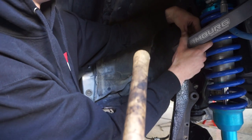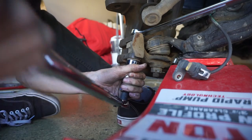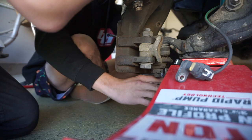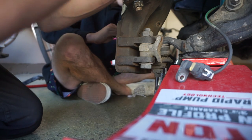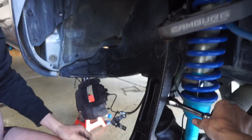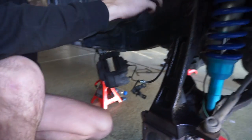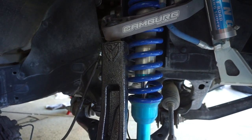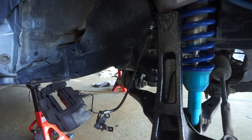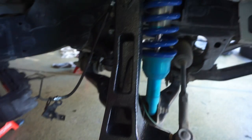Would you care for a mallet? This is making my life so much easier on so many different levels. This is some of the stuff I was cussing out and complaining about yesterday at like 7 o'clock at night trying to do these by myself. Now we just need to wrap a 19-millimeter around the castle nut on the bottom, tighten it up, and line up the hole for the pin to go back in. Then the ABS is next. Got to bleed your brakes. Oh yeah, I have to bleed my brakes too.